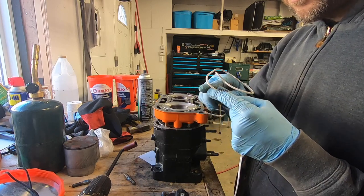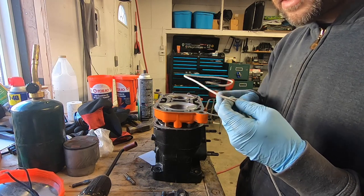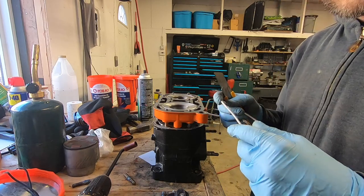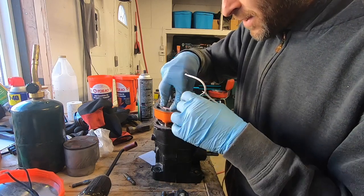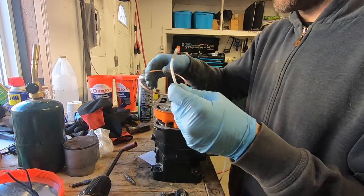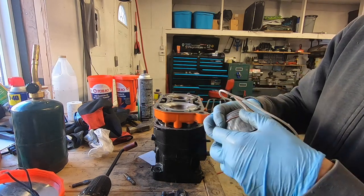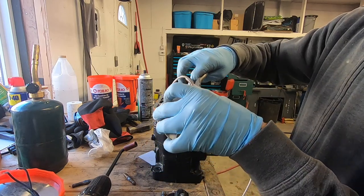Now I'm stripping some copper wire. I'm going to anneal it with a blow torch and then shape it to size, cut it to size, and basically torque the head down and see if I have proper clearances. I could just wrap this around the piston — that would probably be the easiest way to do this and then go say half an inch longer. But as you guys know, I like to do things the hard way.